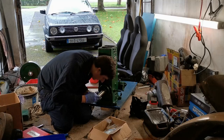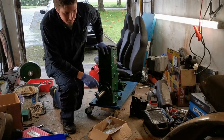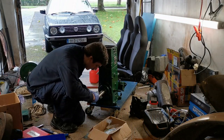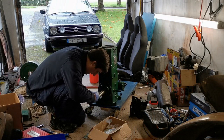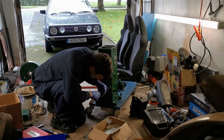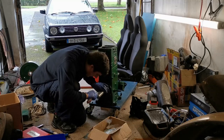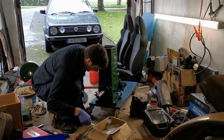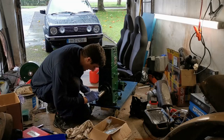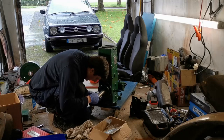Now, what we need to do is make sure that the keyway is nice and clean. So let's get a file for that first of all. I'm going to use a flat file, which is smooth on one side, and carefully run it along here and here, making sure any burrs are taken off. Alright, that feels a bit better. So get a wipe, get your filings out. It's picking up there, so yeah, you can just about see.